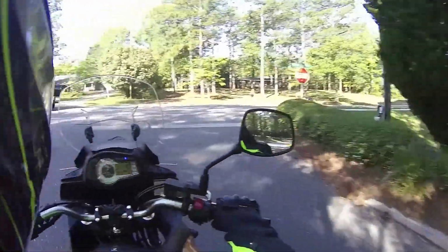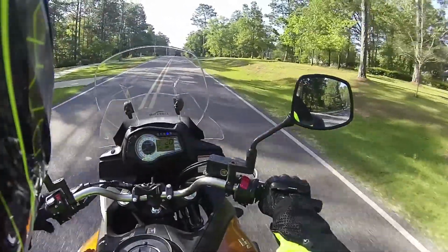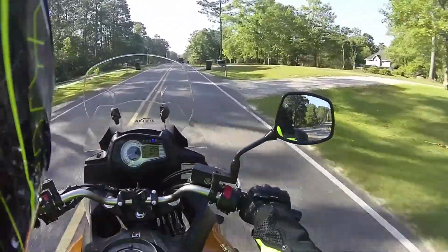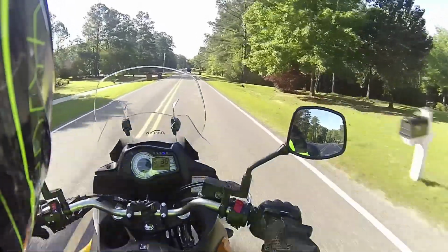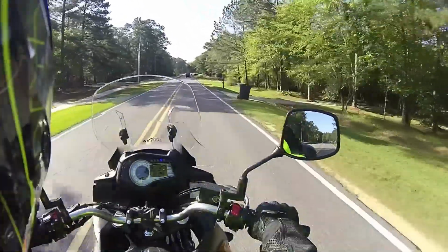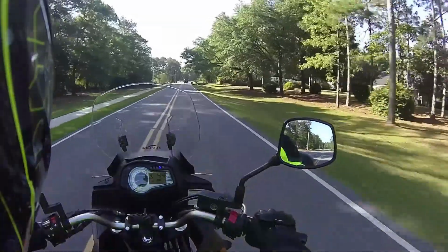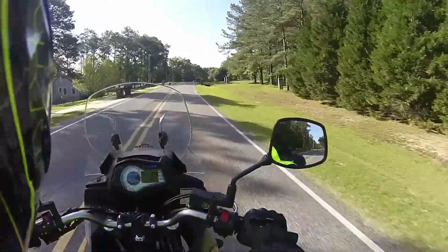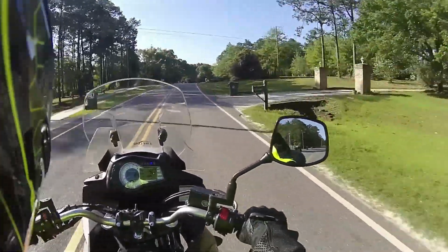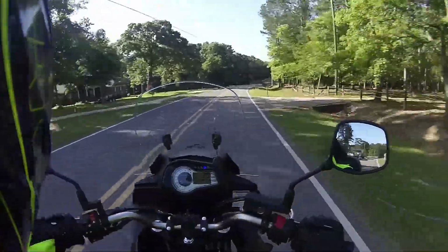The hardest part about the windshield is if you do need to move the little rubber grommets that have female sort of nuts in them, to take the bolt. I don't know if it's really a nut. I guess it is. But anyway, those are difficult if you're moving those from one hole to the other. There's a rubber bulge, and you really have to use some pliers and tug on those, and you think you're going to rip them, but you don't. So that's the hardest part, and I'm not even saying that's hard. And then you just put the bolts in, you just follow the directions, washer, spacer, rubber washer, what have you, and put them in. That's easy peasy.